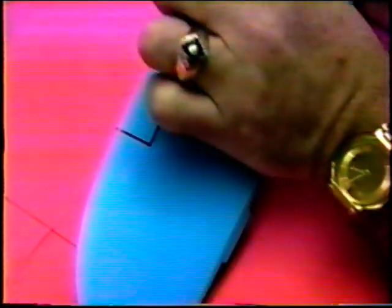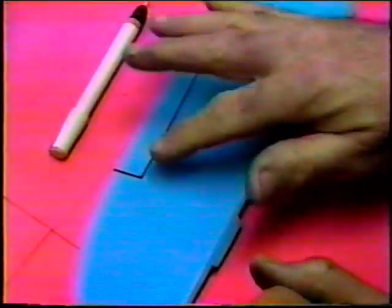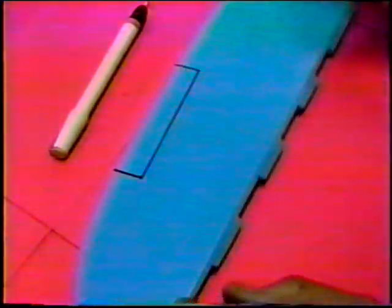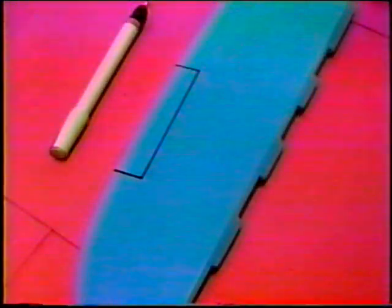And then as soon as I get one part done, I'll shoot a coat of clear right on the edge, just over the ink line, so it'll protect it. If I get by with some grease on my hand or whatever, it won't smear. Another trick that I haven't tried in a long time is, if you don't get nice true lines, rub talcum powder. Sand the plane with talcum powder, wipe it all off, and usually that'll pick up any of the grease or oil. But because we have Flex Oil and fisheye in the paint, you hope, cross your fingers, you're going to get nice lines for the whole plane.